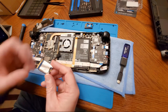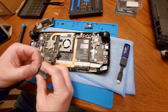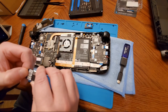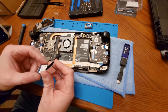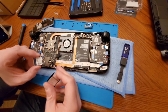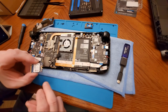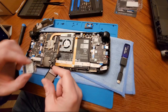On top of the SSD there is a heat shield — do not throw this away and don't pull it apart or do anything crazy. We're just going to pull the sleeve right off of the existing one. This applies whether you're doing a 64-gig model or otherwise. This is the 512 card I put in here the other week, and the sleeve will slip right over the top of the new drive.